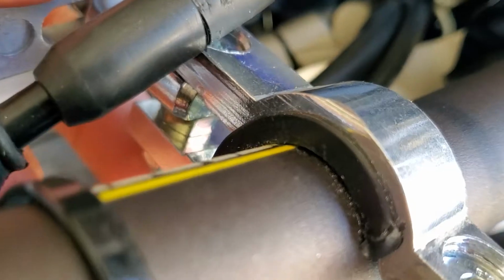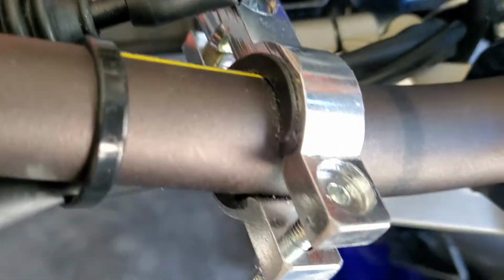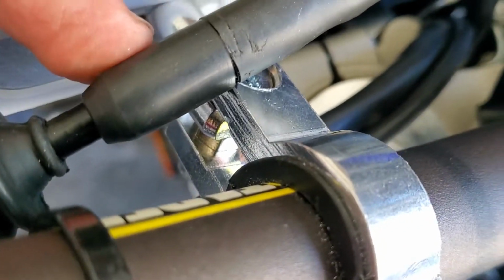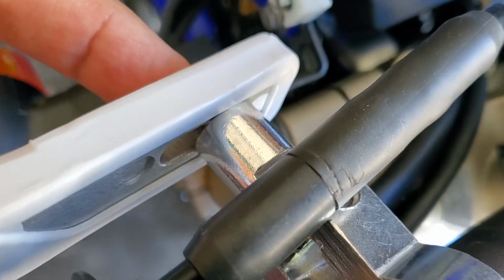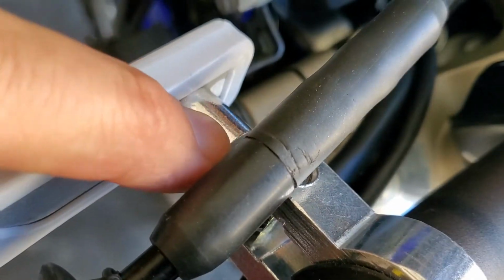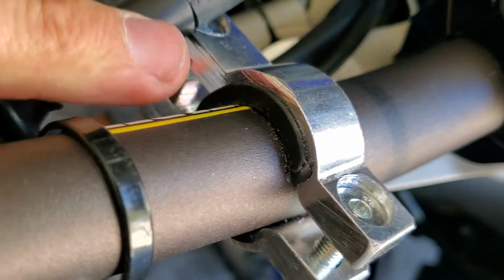One thing I did need to do, you'll see down in here, at the tip of my thumb there, there's a little nut. So you're going to kind of want a spacer, I believe, maybe washers, nut, whatever, to create some bite on that side. Otherwise you seesaw too much. You scissor this wider over here. You want to get a good bite over here, possibly. It depends on your bike, of course, and your handlebars. And then this won't rattle. So I've got a real tight bite because of that additional spacer nut I put on there.